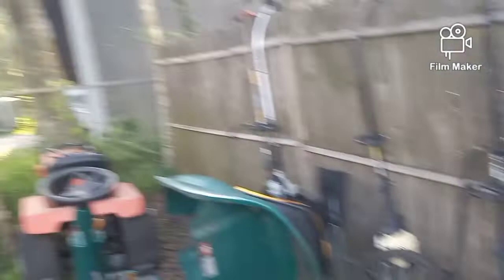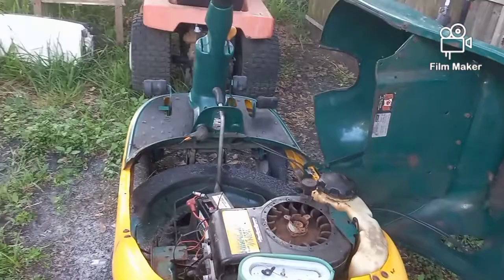Reverse is fine, but reverse with the blades on will shut it off. What we're trying to find out right now is if your solenoid is bad. Turn the key to the middle position, use some pliers, touch both bolts together — it'll spark on you, so press hard and hold it for a second. That's what I always do first to find out if that's the problem with my starting system. If it starts that way, wonderful — turn it back off.